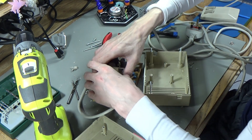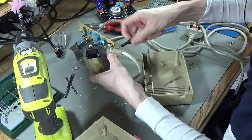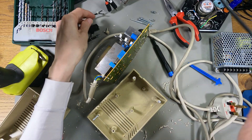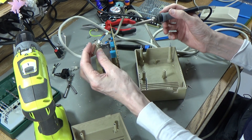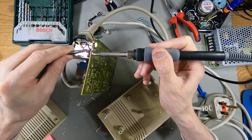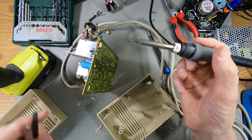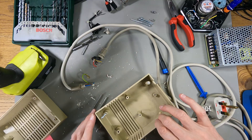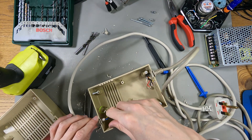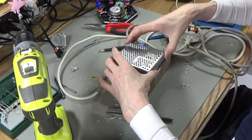It was held in by the transformer, but it's out now — so that's a working power supply, or it was. I'll just attempt to desolder this. That's my main switch — I'm going to need that. I'm desoldering these because there's not much cable on it so I want to keep as much as I can. Let's desolder the Amiga side as well. That old solder smell! That's the bit we don't need anymore, and here we go — we're just left with the stuff we need, including our power switch.